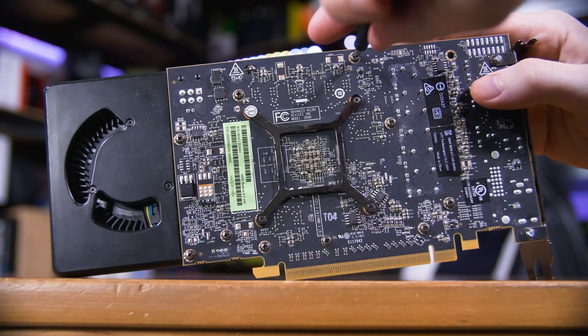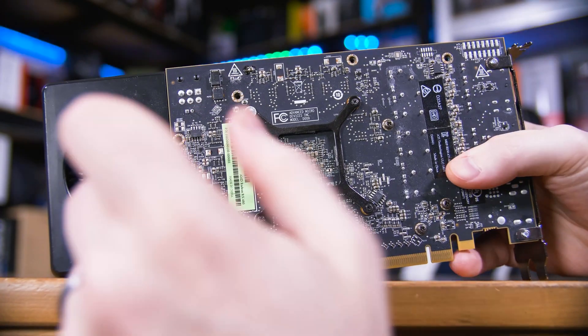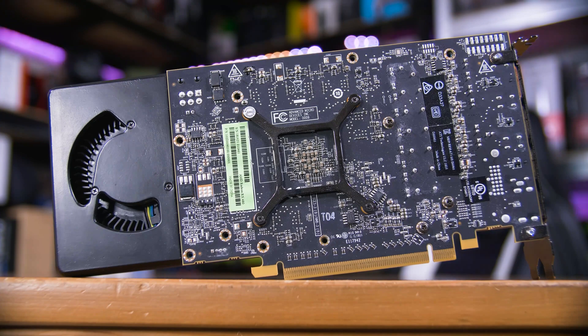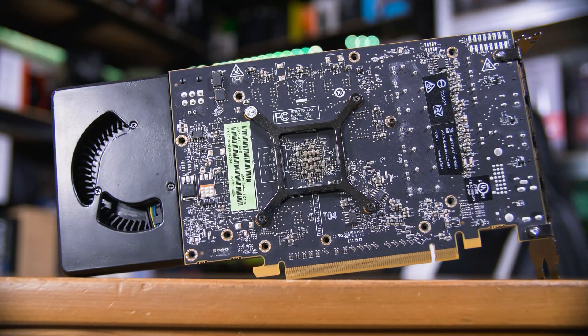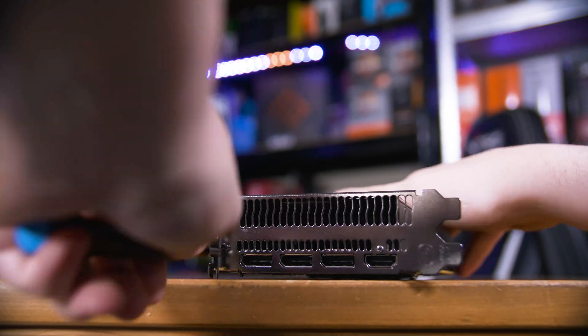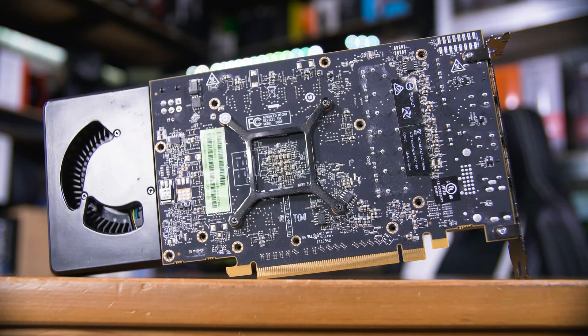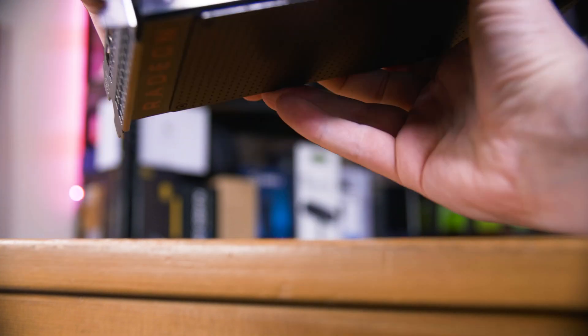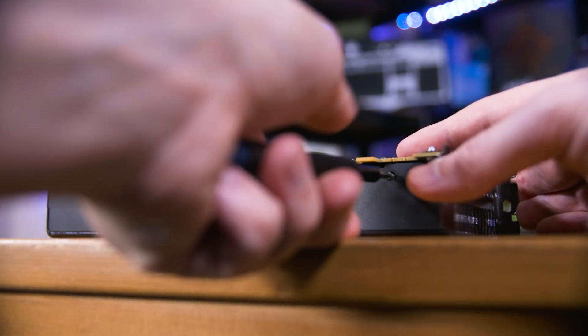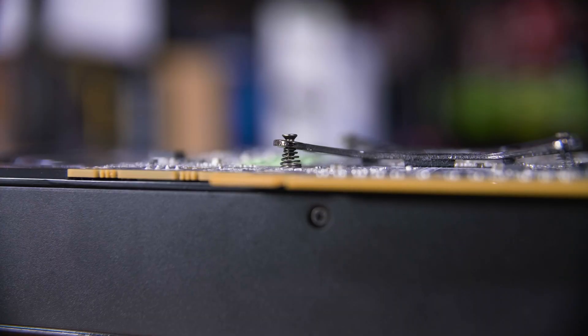When it comes to dismantling the card, on the back you'll often find two sort of sizes of screws, and often the smaller set around the GPU die itself will have their own little back plate or brace. Then you'll often have a larger selection of physically larger screws that hold the heatsink to the PCB itself. On the RX 480 you also have three small screws on the sides of the card that hold the cooler's plastic shroud on and a couple of screws on the rear I/O panel that you want to remove as well, and then once all of those are out you can carefully pry pretty much everything apart.